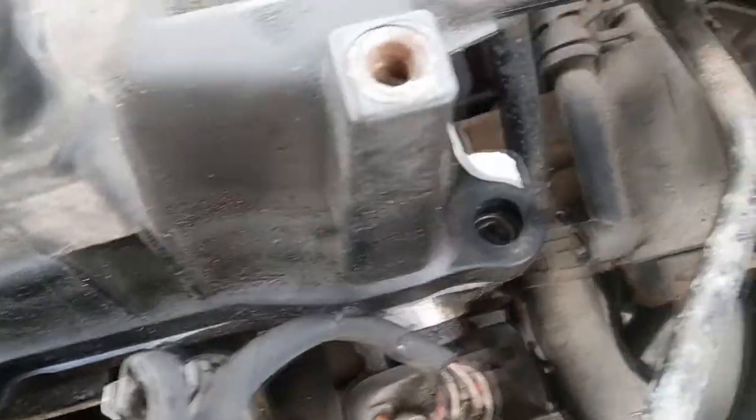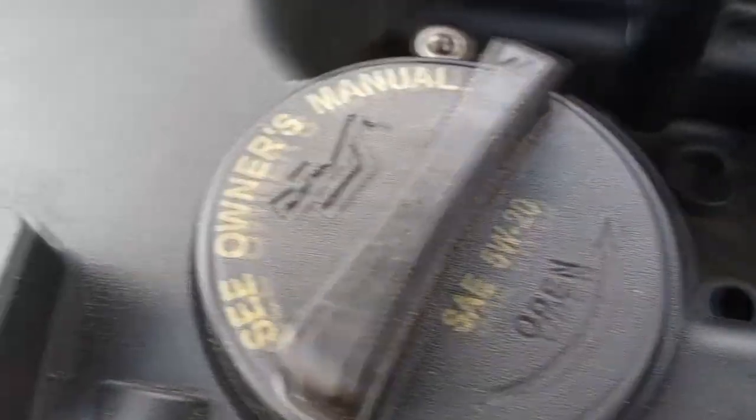2 hours later. All right, valve cover has been replaced. Now what I have to do is put in all of these bolts. First thing you want to do is put in all the bolts and where they go. Don't tighten them or anything, but put them in where they go. And then you tighten them up in later, and I will show you the diagram for that.